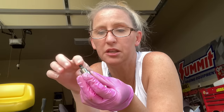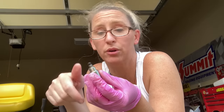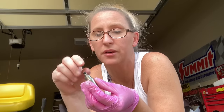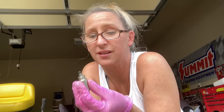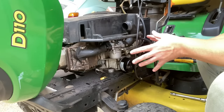We're going to have to take the carburetor off. If you pull your fuel shutoff solenoid out and it will not be pushed down — it should be an easy plunge just pushing it up and down — this one is actually stuck in the engaged position. A lot of times when you open it up after it sat, it's stuck up and rusty inside; when it's stuck up it won't let any gas come through. This one being stuck down means the jet inside the carburetor is clogged up, so I've got to go further.